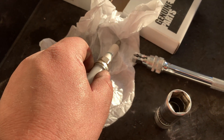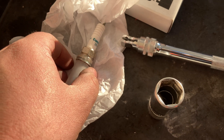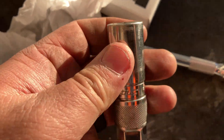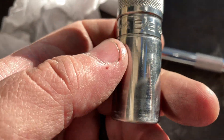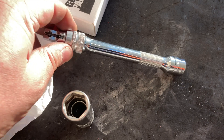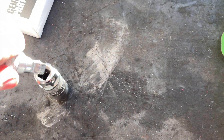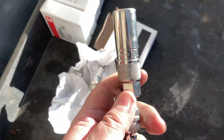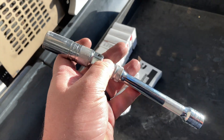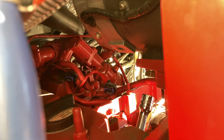It's critical that you keep your spark plugs clean — basically don't touch the porcelain part with your greasy fingers. They do come pretty well packed. The thing I like to use is a Snap-on magnetic spark plug socket, just your standard 5/8ths with nice knurling on it. I also like to pair it with Snap-on's wobble locking extensions. When they're locked in there it won't fall out on you into the bore, and it gives you a little bit of wiggle room and play. We'll start pulling plugs one through three.